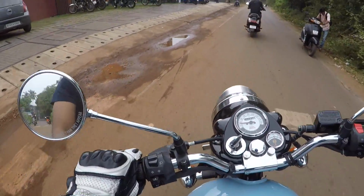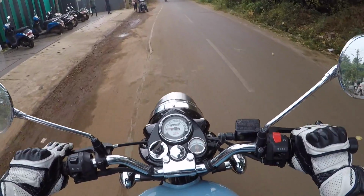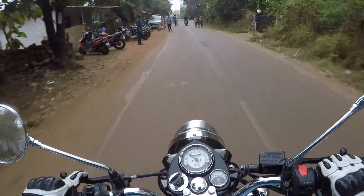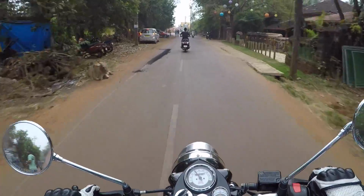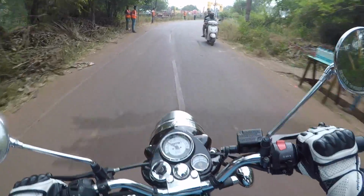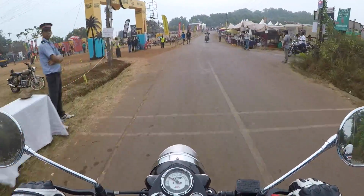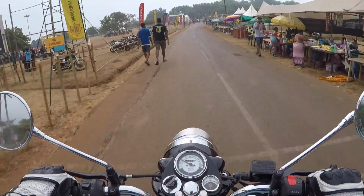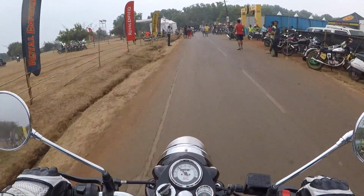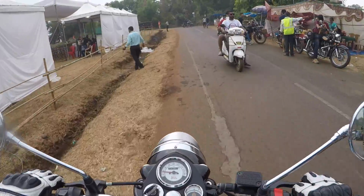And to tell you exactly how less the performance is, I've put it in first gear and here we launch the bike. So there is the pull, there is the torque rush thanks to the 28 newton meters of torque, which comes lower down in the rev range, gives it good amount of pump. Peak torque actually comes in at 4000 rpm, but there is good amount of low end punch. So it's a very punchy motorcycle to ride thanks to the torquiness of the engine. But other than that, the problem is that this torque rush gets subsided quite quickly.